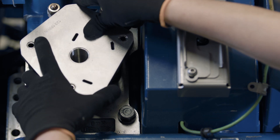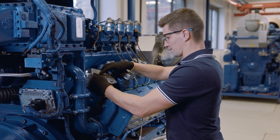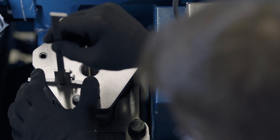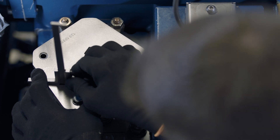Next, I set up the measuring device, which can be fastened with a screw. I now use the depth gauge to measure from the top of the valve spring plate to the measuring device, first at the long inlet duct.